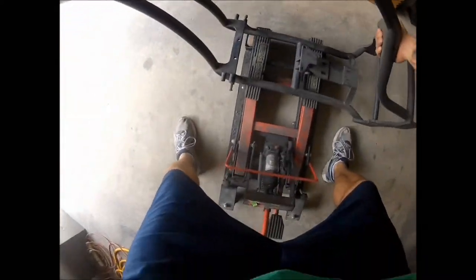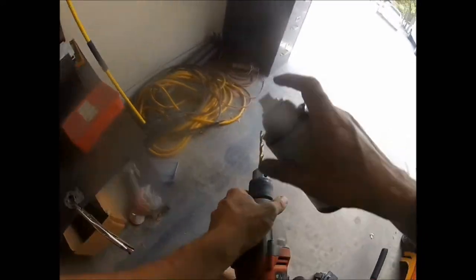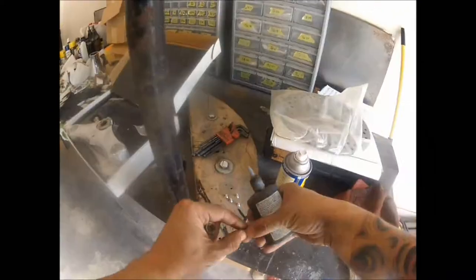Jack in position, and the first piece is the frame. I had to drill out the fork stop so I could mount it to the lower tree. Insert the stem through everything, then install the trees and bearings into the neck of the frame. Pound in the swing arm bearings and mount it to the frame with a pivot.